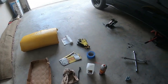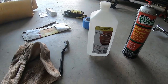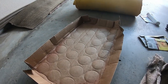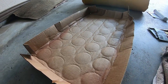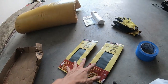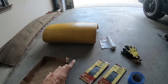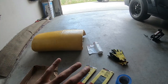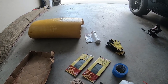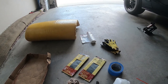These are the tools you're going to be using. First, you need brake parts cleaner - I got this from O'Reilly's. You're going to need some alcohol, a wire brush, a dirty rag, and a cardboard tray to have under there because once the paint starts coming down it's going to be dripping. Sandpaper - I believe 1500 grit and 2000 grit - blue tape, gloves, trash bags, and a yoga mat that my friend gave me. You can substitute the yoga mat with trash bags around the body when you're about to paint so overspray doesn't get on it.